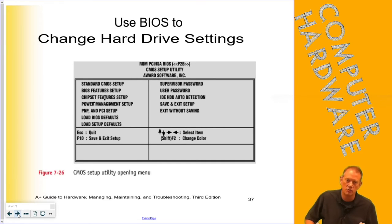Whenever we install a hard drive and set it up, we need to go into BIOS and make sure we see it. This is an old BIOS, but we need to look under the hard drive section for the drive we just installed. Anytime we're having hard drive problems, BIOS is the first place we should look — does BIOS even see it? My son's D drive just failed this weekend, and when I went into BIOS it wasn't there, and that drive is probably gone.